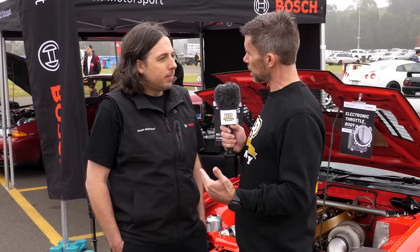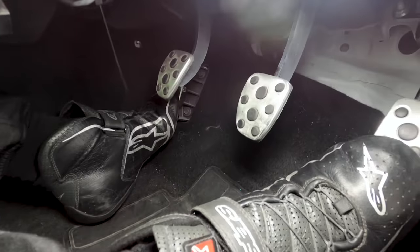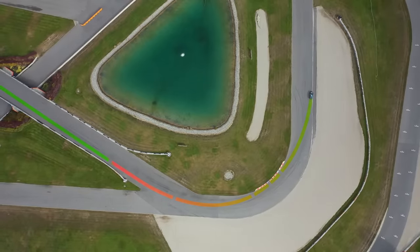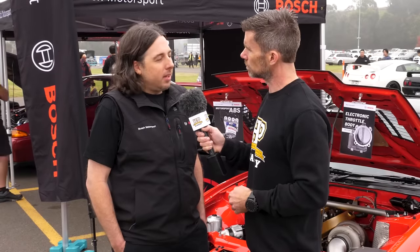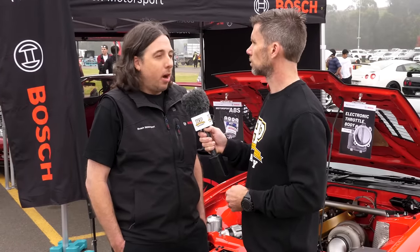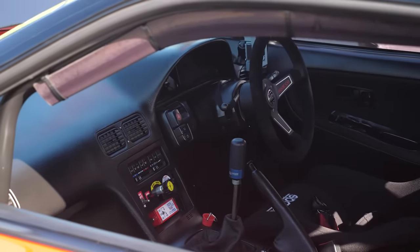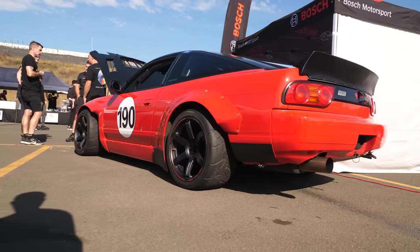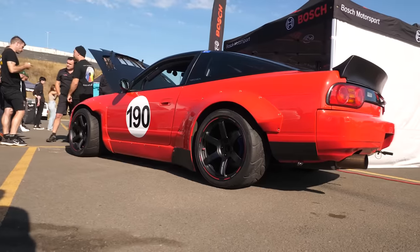Regarding driving style with a proper motorsport ABS system, it's a big change for seasoned drivers not used to motorsport ABS - you have to retrain your brain. Rather than a sharp application to drop the nose and then bleed the brakes off, you don't do that with ABS. It's a sharp application and hold, maintaining through the braking zone. You want more pressure than you'd typically produce so the ABS can bleed off that pressure to reduce lockup, but then has excess pressure to reintroduce. The wheels need to be able to lock under all situations so the ABS can modulate, because it can't generate pressure - it can only take it away.